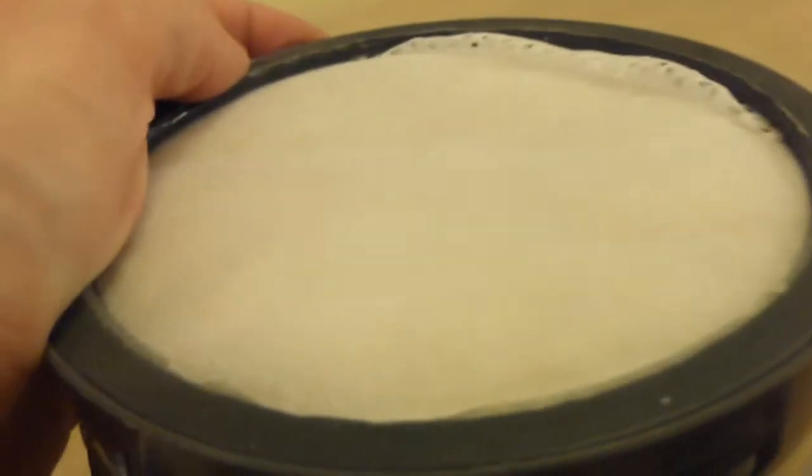And all that happens is, you're drawing your dirt in through there, it comes into the bin, it doesn't spin round properly. Well, it may do actually, because you're still drawing the air in. So you've got your first cyclone in the outside of the bin. But then it was getting drawn up through a big gap underneath that rubber seal, because on this machine, that wasn't meeting the bottom door properly. So the dirt was coming in through that gap, going up the centre tube, which it shouldn't have been doing, and then it was entering the cyclone cones from the base, coming up the cyclones the wrong way and going straight into this top filter.